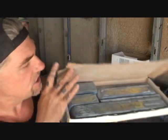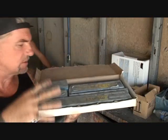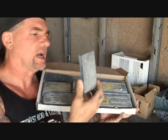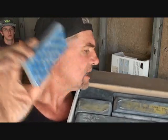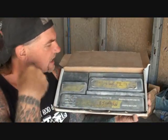If you're going to be a professional paint and body guy, you're going to have to know how to hand sand. Hand sanding is using a hand block such as this one right here. This is a kit that you can buy that has various types of blocks inside it. There's also one other block added to this — this is a perforated hole block, they call it the big blue block. This is a very handy block for wet sanding and dry sanding.